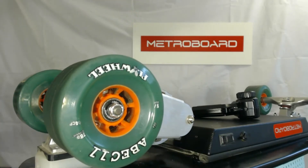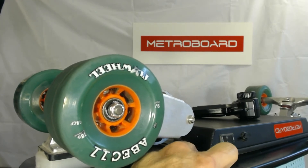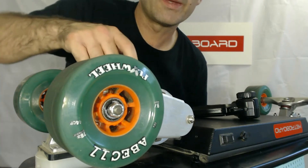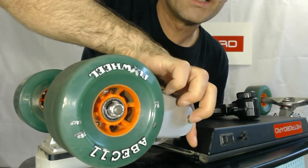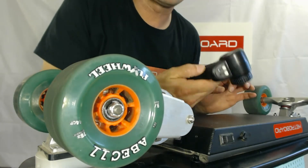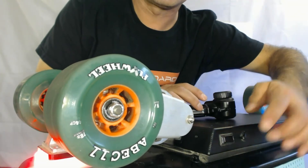Okay, we're finally in. It's a little tricky because you can't really see it, but once you get it in you'll know — you can kind of see that it can't go any further. So right now we've got the bind plug in the bind connector. What we want to do is keep the remote off for now, and this is the new remote — the one that you want to bind to. Go ahead and turn the skateboard on.